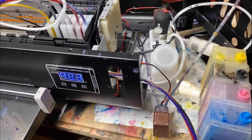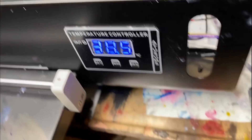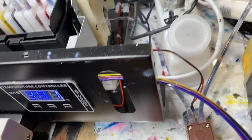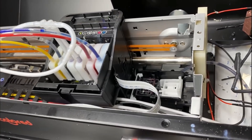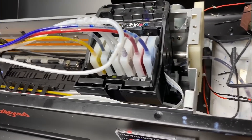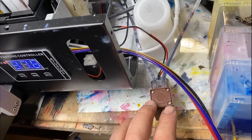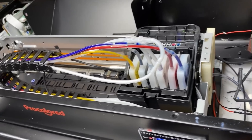You can hear the pump is running. Because it runs twice a day, once it goes out of sync you get a double error light. It may or may not happen, but it happened to me a couple of times. You have a printer that runs fine for a couple of days, and then suddenly one day you come back and you get a double error light.